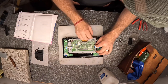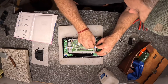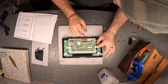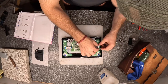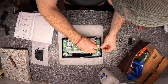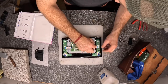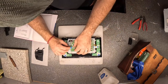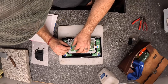All right, so that ribbon cable from the new, yeah, our leads are good. From the new digitizer, open up the plastic fitting, and that looks like what it looked like prior. This ribbon cable from this board behind the LCD back into its slot. Let's see, I'm gonna kind of pry it up and do it this way so I have a little pressure to hold the ribbon cable in place, and then close the plastic retainer. Pops back in. Nice. And the one on the far side is all just controls for the volumes and the apps and the settings and menus along the side. So there we are.